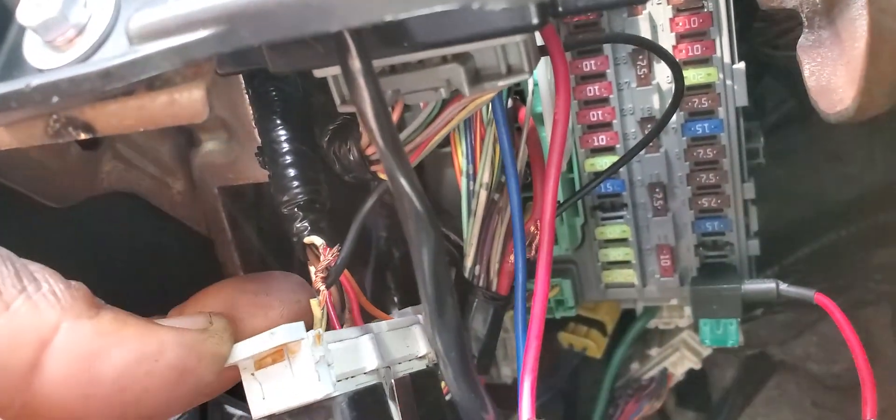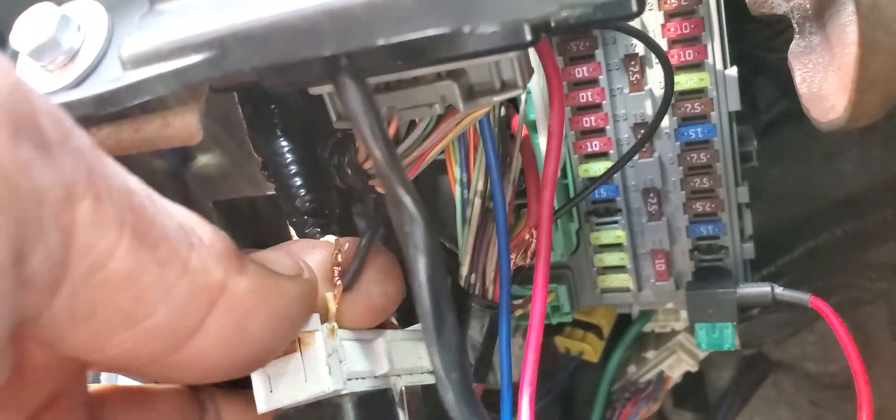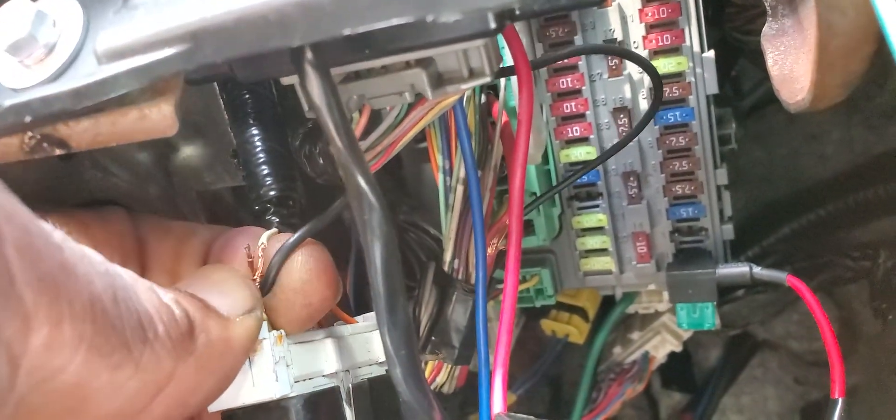The wire doesn't just stay there. The fuse box has a computer inside — one line feeds the computer and one line goes through it, through the wire, and comes out to feed the OBD2. Because I don't know if they need to change that piece or what they need to do — I have not done anything because there is no power.